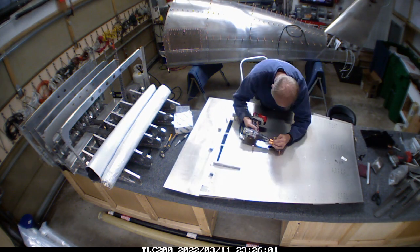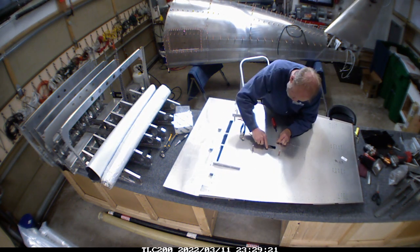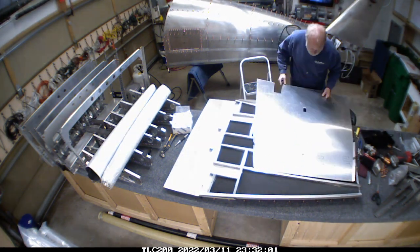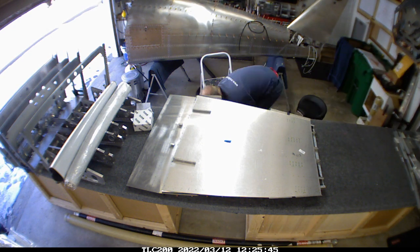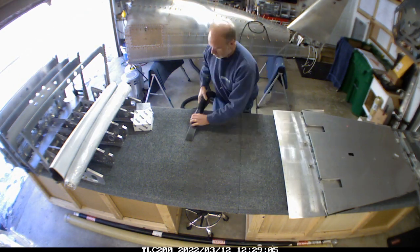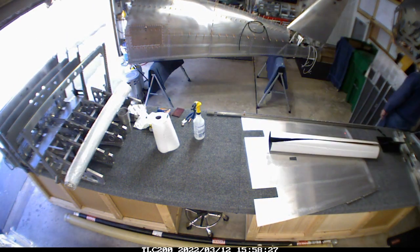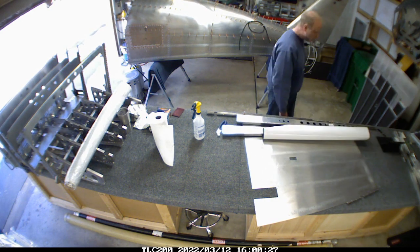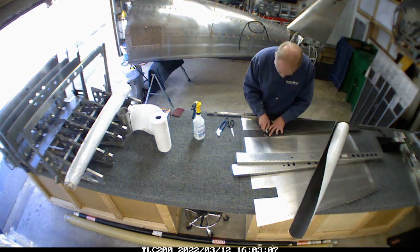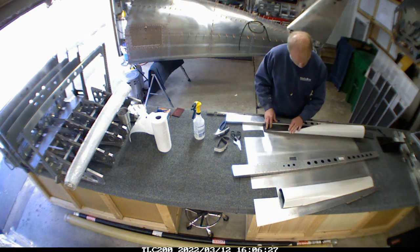Here I'm opening up the hole for the transponder antenna. That piece goes pretty much directly — the top skin opens up to the bottom skin. As per the instructions, I just opened up the hole a little bit better to allow for the transponder to be attached, because once it's a sandwich of the top skin and the bottom skin and you rivet them together, there's no way to really get in there. It was also recommended to do some additional sound proofing or insulation on the top skin to just double layer up, which helps with the quietness of the airplane.